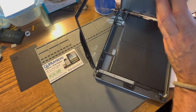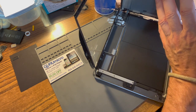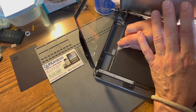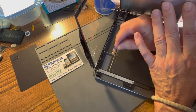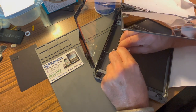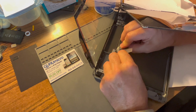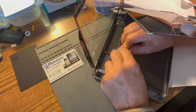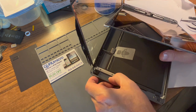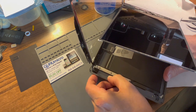I'm going to add very little heat — not much at all, just blowing some warm air from a distance. I'm going to try this tool under the board right here again first because the board is glued, which makes it difficult to get the tool in there sometimes. This one is tough today — that thing does not want to give. There it went — I got one side in and the other side is in. Now I'm going to hit the power button and hold it for like five seconds. I'm watching the screen to make sure it does not turn on — and it's not. So that's good. We've drained all the power off the board.